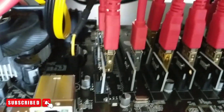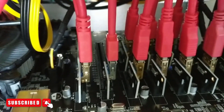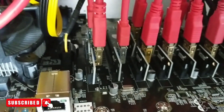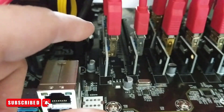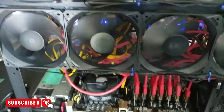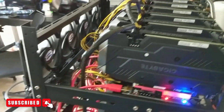Another thing to be very cognizant of: if you have exposed wires or fan controllers, please find a way to insulate them — any exposed 12-volt lines around here. I actually had a GPU go out because of that issue. Make sure nothing is going to come in contact, because even if 12 volts touches and shorts out on the USB connection here, that can actually fry a GPU and it won't be detected anymore. That's something I learned that you can learn from my mistakes as well. That's how you go about locating a faulty GPU on a rig.